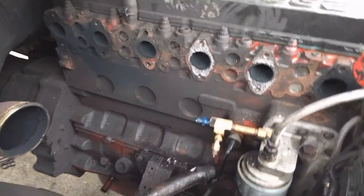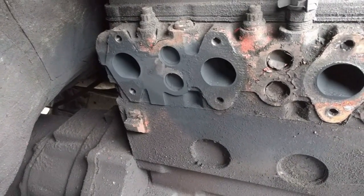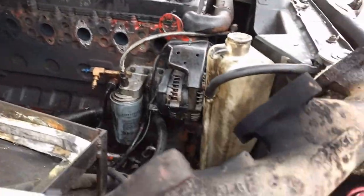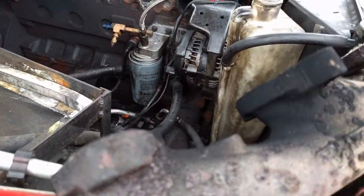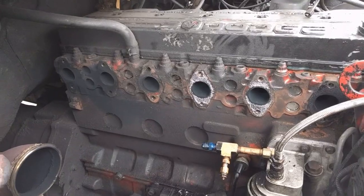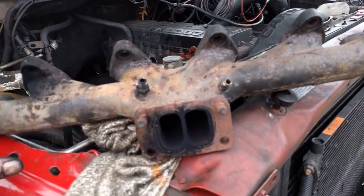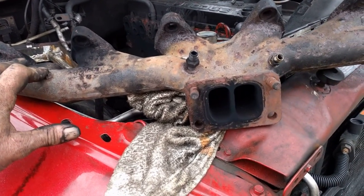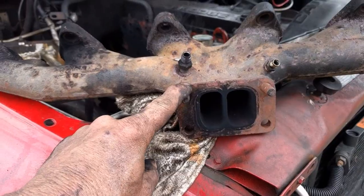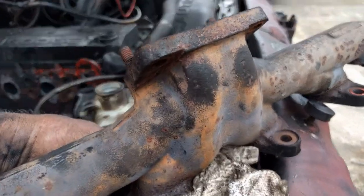I got everything off. As you can see, the blackness coming down there is my exhaust leak — I think the last two were leaking. With everything in there, all I could see was smoke coming out everywhere, and you can see on my exhaust manifold how it's black. I got some gaskets I'm gonna throw on them once they're cleaned up. This is like one of the first steps: you have your exhaust manifold, using your stock exhaust manifold, which I've never had any problems with.